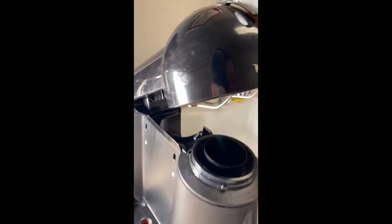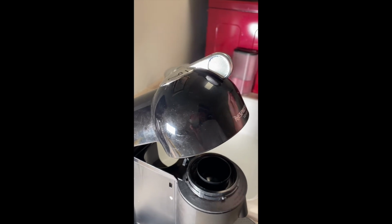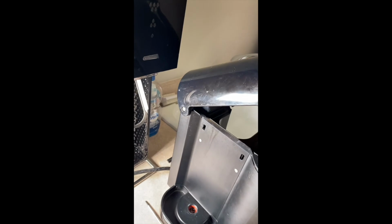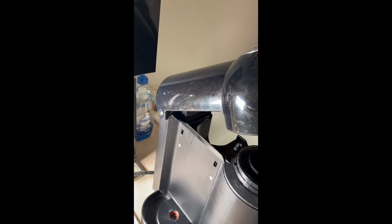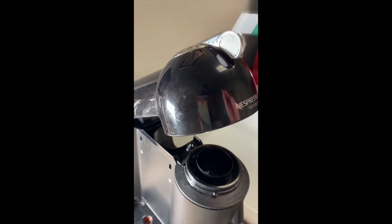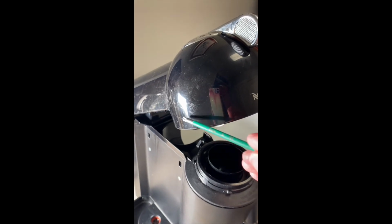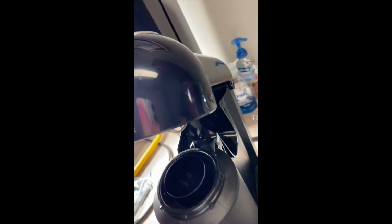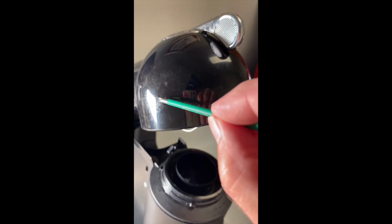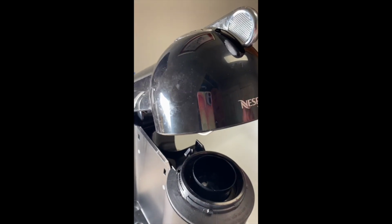I should mention that within the lid, there are 2 plastic snaps, so just getting those 4 screws off does not make it so that this lid just comes off. You have to carefully work and spread this dome part out such that you release the plastic snaps inside the lid.